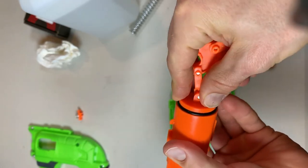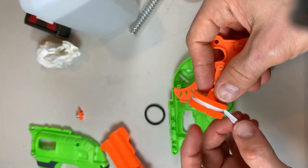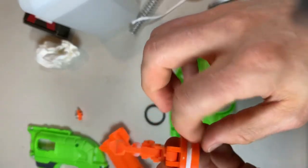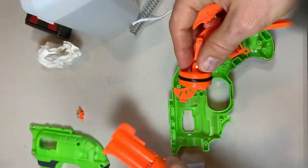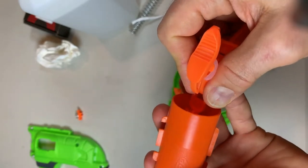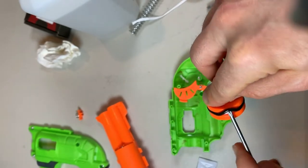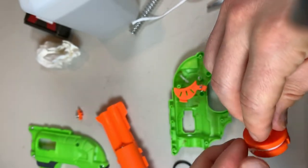Okay, so that's a bit much — so glad that happened so you can see what happens. We're just going to have to back this off probably a full wrap. Let's trim off that excess, roll this back on and see what we've got. It doesn't want to move back — that's still a little bit too tight. So we're going to take off one more wrap. It looks like this is probably good on about one to one and a half wraps of T-tape to give it the expansion it needs.